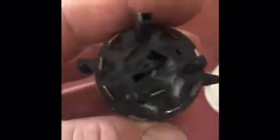So here's the back side of the ignition switch that I pulled off. I've already cleaned up the terminal. It's the one in the center there. I'm going to solder a piece of wire on there, as opposed to using a connector, because these fail all the time, and fail because that connection gets loose and then it burns up. So I'm going to just solder a piece of wire on there and then put some heat shrink on it. Here's the finished product of the solder. All I did was solder a piece of wire directly onto that post.